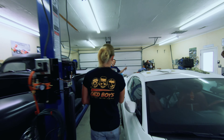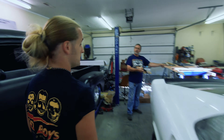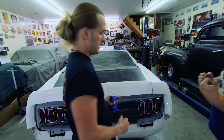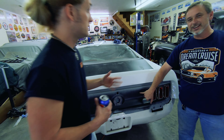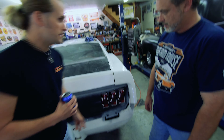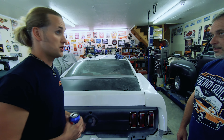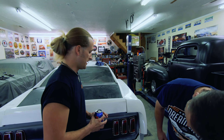Anyway, changing up the front end of the car quite a bit — adding hood pins, changing the lines of the car. This doesn't look like a Retrobuilt. The Retrobuilt cars all utilized an 05-09 tail light and then it dipped down in the middle. Something I wanted to do was use a real 69 Mustang tail light handle. It's metal. Here's what's really cool — it's removable. You unscrew it here and here. The bumper goes over and yes, we actually did end up moving the bumper up about three quarters of an inch to match more of the 69 accuracy.